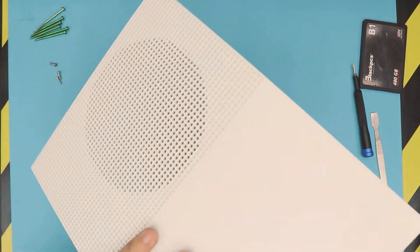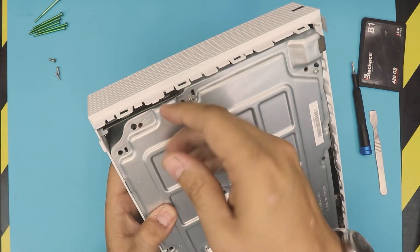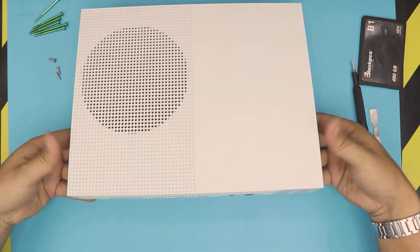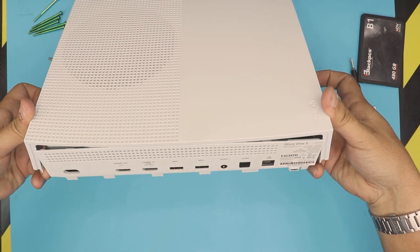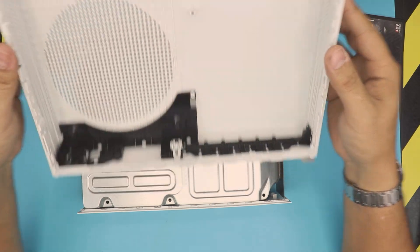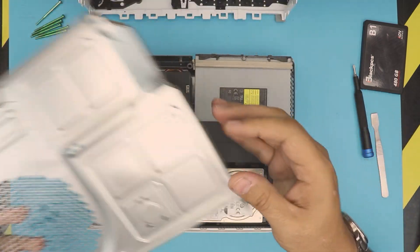Now put the console in normal position. Grab it from the plastic end at this corner, put your hand in there, and push the plastic apart on both sides. Open it up and the bottom is just going to fall forward — move it forward and pull it up. That's the bottom top cover. The metal cover will then just lift right up — that's your top metal cover.